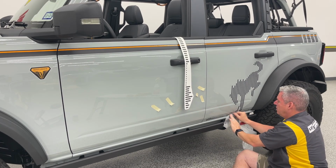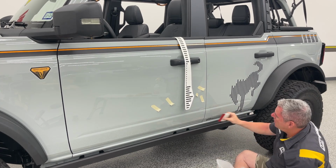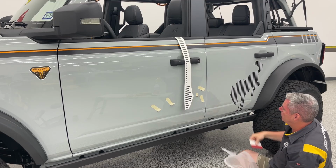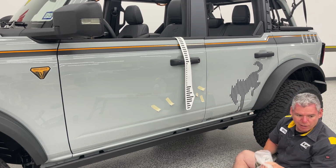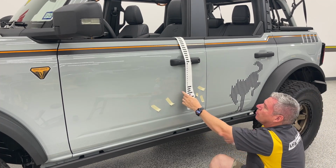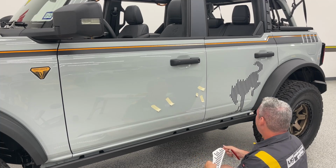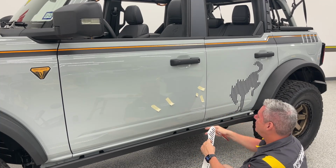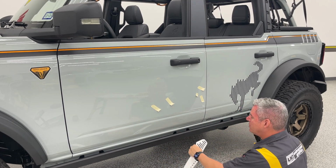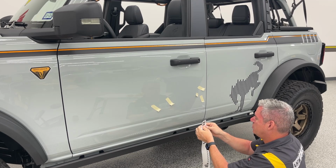This is very slick. And once this sets, once that adhesive sets, it'll be fine. If it gets outside, gets a little heat on there. And just like with our wrap films, 3M 1080, Avery Supreme Wrap 900, or Oracal 970RA, we do recommend a post heat about 180 degrees, maybe a little bit hotter. Again, there's no serious contours on here, nothing that's going to stress that vinyl, but a little bit of heat will show you if there's any spots you didn't get that good tack on. So you can go back and check that with a little bit of heat, just for insurance to make sure.